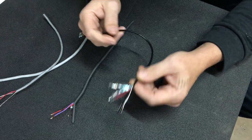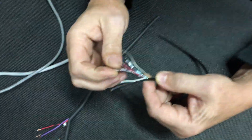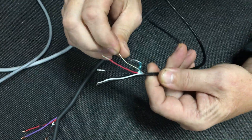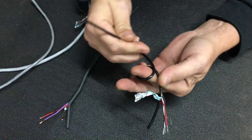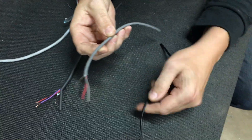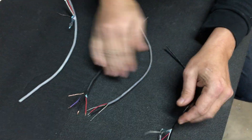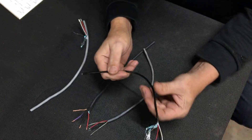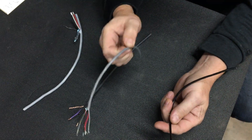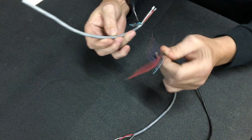This wire here is my preference — it's a 22 gauge with a polypropylene insulation on the wire and PVC jacketed with a foil shield and drain wire. This is very light, very flexible, just a little over an eighth of an inch in diameter. This one is about 140 mils in diameter, whereas the Holley is like 200 and the Belden is over 200, and this is about a quarter inch. If you have 60 feet of wire in a car, this weighs less than a pound for all of it, while the others are just over a pound each.